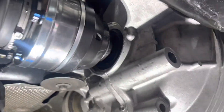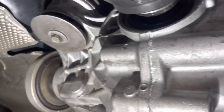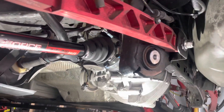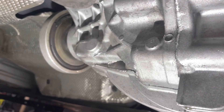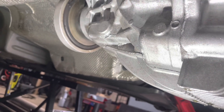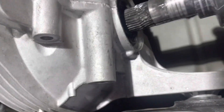Moment of truth — I took off the entire hub just to get the axle out, which seems to be the only way with these axles. Let me see if I can get this out finally. I need a crowbar or pry bar to push on it. Try not to hit against the seal. Let's see... got that out. Oh, it's out! Sorry for the weird video but I don't want to drop this on my head.